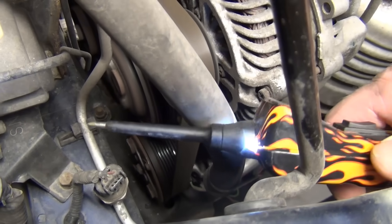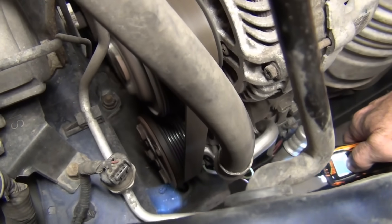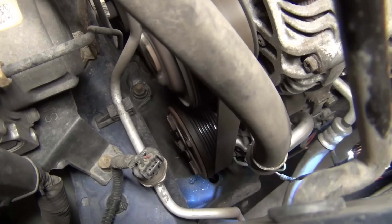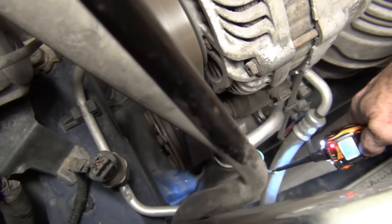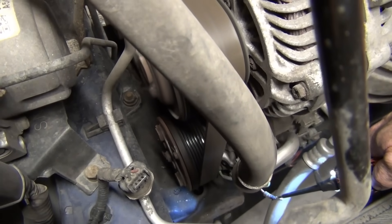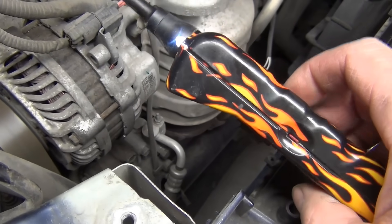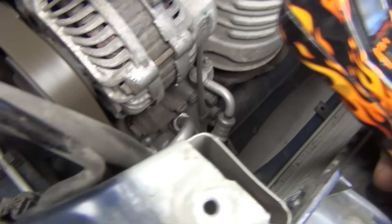The engine's running — you can clearly see the pulleys are moving and the belt's going. So if I put power to this, that electromagnetic clutch should engage and spin the middle of the compressor. Watch for the red light. I'm running power to this — you can see it's making contact, but that clutch is not engaging. It's not doing anything at all. I'll put a link in the description for a power probe like this — this is a third generation. I don't know if I'll find one with flames on it, but I'll find the best deal I can for you.